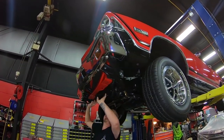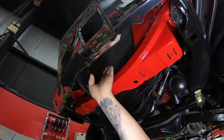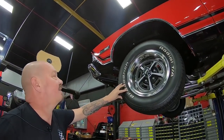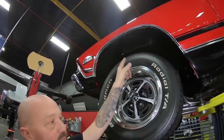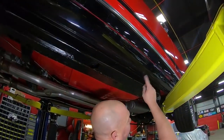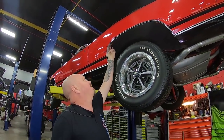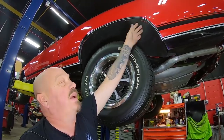Front frame horns are nice and straight, core support looks good. This is something you want to check out on every one of these cars — take a look at that core support, one of the first things to go on these cars. Back side of the bumper looks like it's brand new, so that front bumper is definitely new — you can see all the new hardware up in there. Tires are BFG's, looks like they are 245/60/15s on some good looking painted rims. Center caps look good, trim rings look good, inner wheel houses are nicely painted, frame is nicely painted. This pinch weld is beautiful — this is something you need to look at on every one of these cars. I always just run my hand on the back side and that will tell the story right there — that's nice and smooth. Out back here, 245/60/15s, and check this lip right here — all I feel is nice smooth metal there.